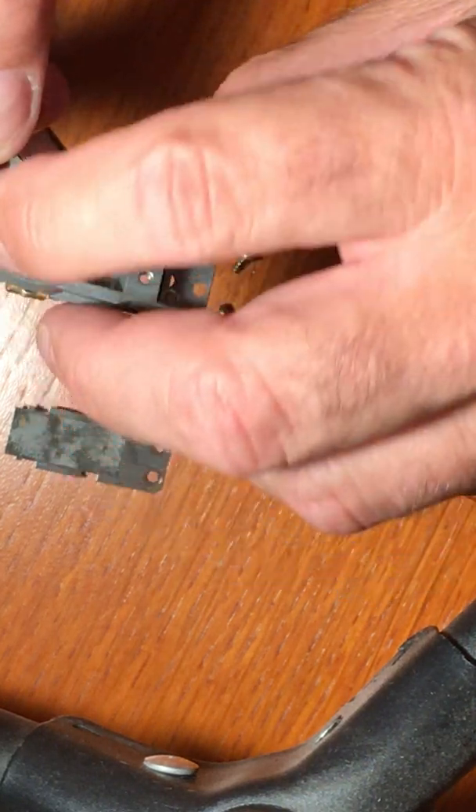We'll get that great glide when the power is cut off, but when that actuator reed comes down towards the coil and presses it down, it's touching that drive gear — so we're going to get some good play there. Now this is critical. You look at the profile here and press that actuator reed down, and see the contact on the brush plate — see how much that's actually unbreaking the contact. Because of the wear of the brush plates over time, that arm can bend. That's why a critical piece of this motor working is actually the length of the push rod and how much it opens that contact point. You don't want it to open too much — you'll hear a lot of clacking. You don't want it to not open enough.